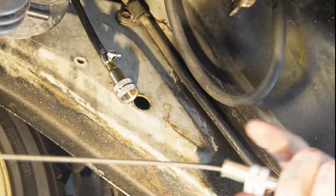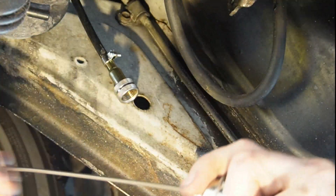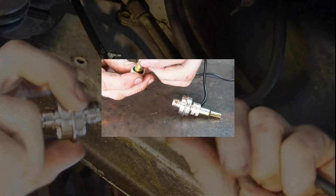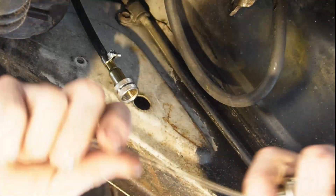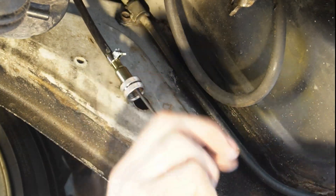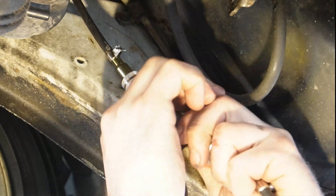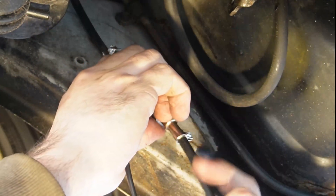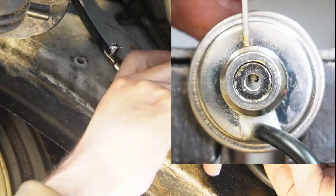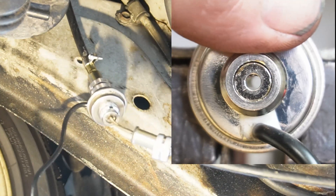To prep this I've already fed the drive cable through the sheath, and then I need to put it through the signal generator — and that's the point you remember you've forgotten the rubber washer. So I'm going to put that on now. With the rubber washer on, we get the end of our drive cable and just feed it up inside the cable sheath, hopefully going up into the back of the speedo drive. This will come together, and there are some little grub screws on there that go into the cable — you have to be very careful with these grub screws. They're turned by the supplied allen key included in this kit.